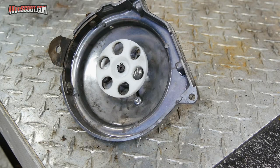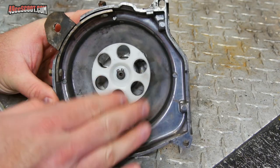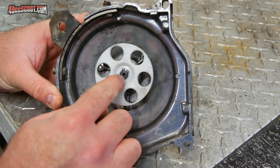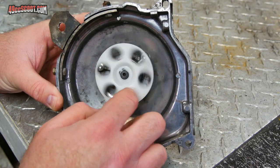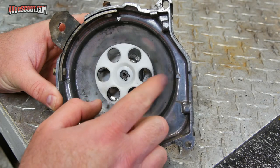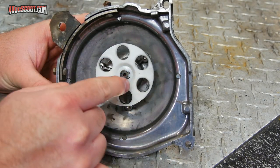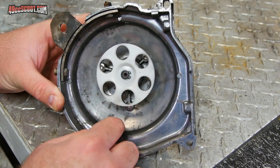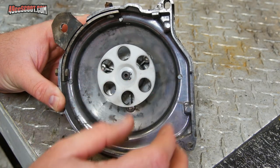I took my helmet off and stopped filming at that point, but I'll use this water pump to show you what I found. Once I got it off of the engine, I saw that the drive wheel was still there, and the circlip was still in place, but when I spun the drive wheel, it would spin freely, it wasn't spinning the water pump. And then I found that the pin that connects the water pump's impeller shaft to this drive wheel was lying inside of the engine. Luckily, it didn't get lost. It was lying in there.